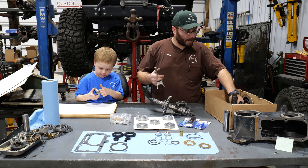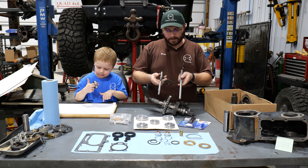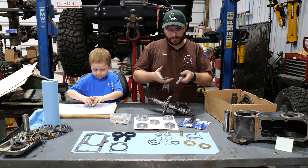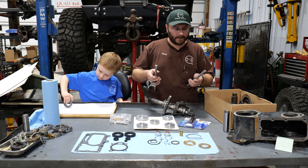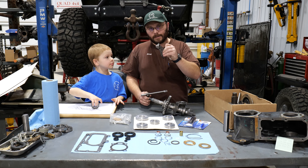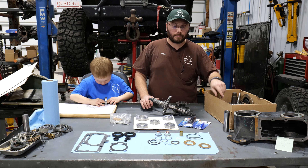If you've got some miles on your transfer case and you begin to start having some shift issues, it could be little bits of glitter getting in where your shift rods go. They're a pretty decent fit, and if much of anything builds up, they're going to start sticking. Oftentimes you can break the transfer case down, take these out, clean everything real good, put it back together and that solves your issue. If it's something more than that, it could be the roll pin starting to come loose, or the bolt — which shouldn't come loose with the tie wire. If you're having any kind of problem with your transfer case, it's better to catch it before you need some major parts.